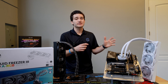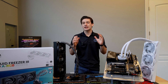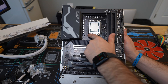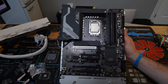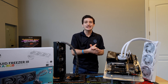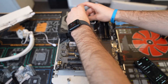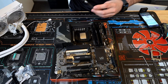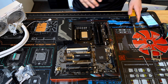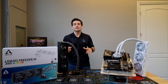Here's the problem I foresee with this cooler's mounting mechanism. For CPUs and motherboards, when it comes to warranty, the mounting mechanism isn't very clear on how much you can change it. If you were going to send the motherboard back, you'd have to put the original mounting hardware back on. They might just void your warranty if the mounting hardware isn't perfectly set, even if it's not related to whatever issue you're having. With that said, installing the bracket was actually pretty easy. I had to use a cardboard box to hold the back plate in place, because on the actual test bench it kept falling off and I couldn't tighten everything down properly — so that's something to keep in mind.